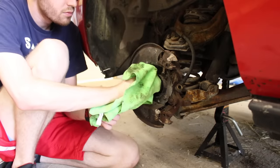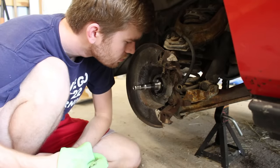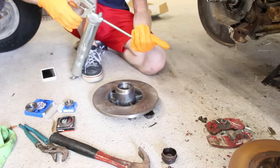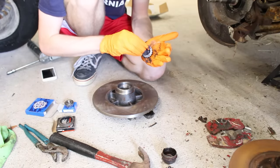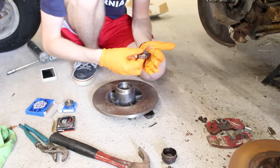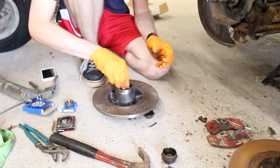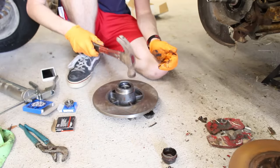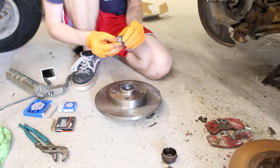The spindle was wiped clean and examined for any scarring, but everything looks good, so it's bearing time. There's a trick to packing grease — apply some in your hand and push the bearing down into it. I probably could have used the grease gun, but I saw this online and wanted to try it out. After the bearing was in, the seal was tapped into place with a hammer. The outer bearing was greased up in the exact same way.